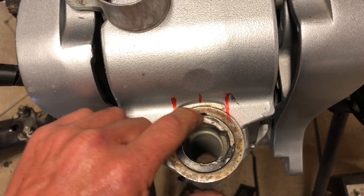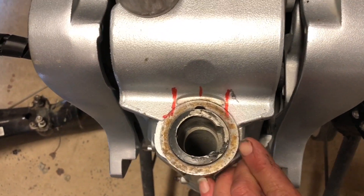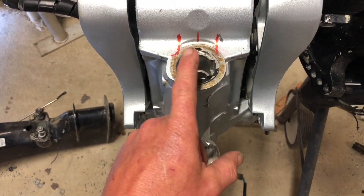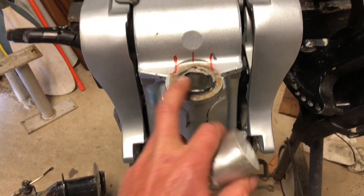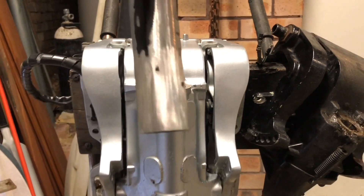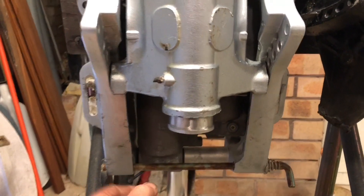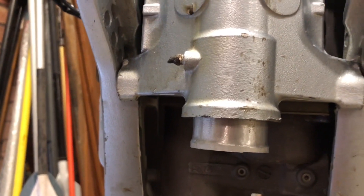I'll put a V-groove around here and weld the two together so it becomes one piece. I'll re-tap the steering friction bolt through. The original factory bushings for the 25-30 horsepower Tohatsu can go back into this. I've made a shim for the bottom of the tube to fill the gap between the Honda bush and the base, so there's no play between the two. I'll hammer that in before welding, then weld the base of the three things together and sand it flat. I'll also reinstate the grease nipple.